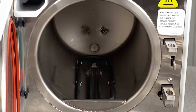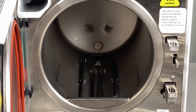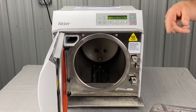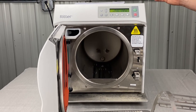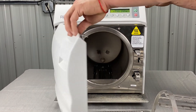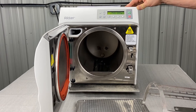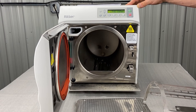That's about it. I highly recommend that you're always draining the water out of these units — that will keep your reservoir clean, your chamber clean, and all your valves and filters clean. It's a beautiful thing. If you have any other questions, give us a call. If you like this video, please share it, subscribe to our channel, and stay tuned for more Midmark M11/M9 troubleshooting videos.